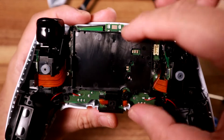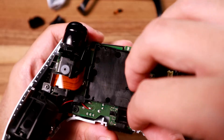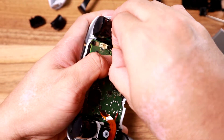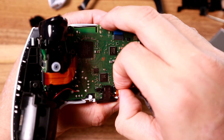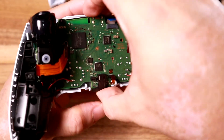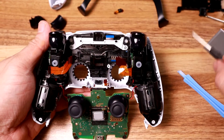Since we're already here I might as well explore a little bit. I've already removed the screw for the battery tray. Now I'll remove the microphone - try not to lose it - and then we should be able to pull the battery tray off. Next you want to remove these two ribbons here. This other ribbon you just remove, and then this front-facing microphone and the touchpad - this always gave me problems with the DualShock 4.